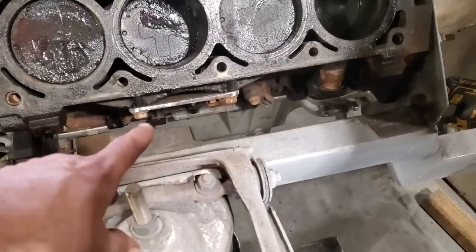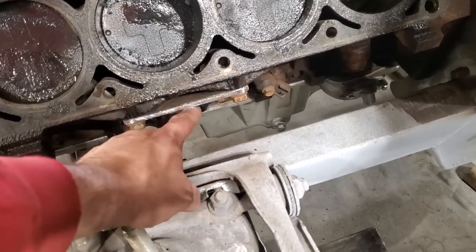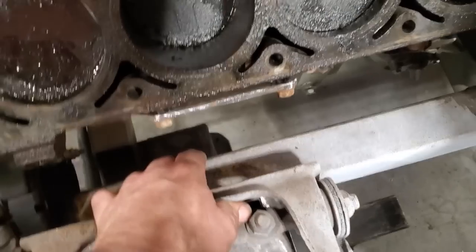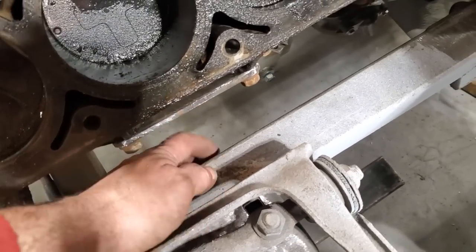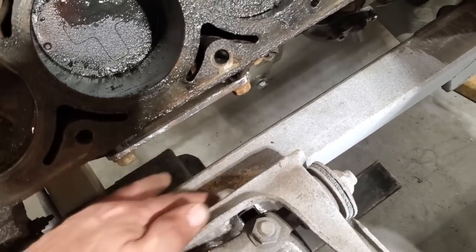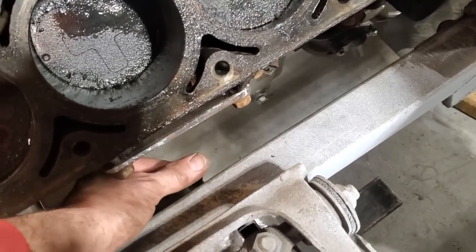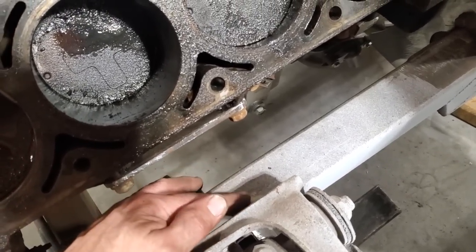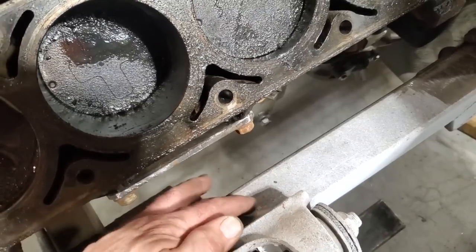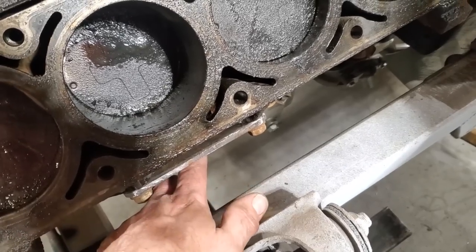So there they are bolted onto the engine. Now the idea I got in my head is I want to run a piece of pipe from here out to the frame rail. Most times you'd be running the plate out to here and running to the side of it. I would like to incorporate both sides of it. I like to take the top in and the side, so that way it's got a bit of strength pulling on it. So it's not just pulling on the side of the panel or on the top of it. It'll grab the bolt and be welded along the top here and down to the side here, and that's how it'll go up to the mount there.